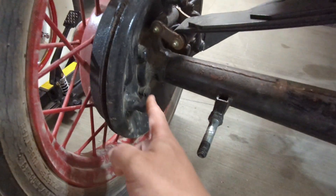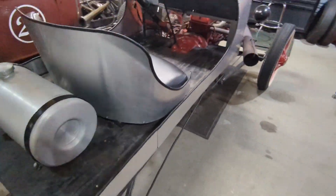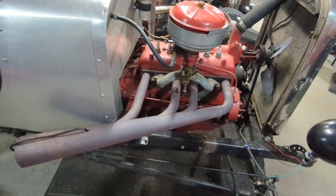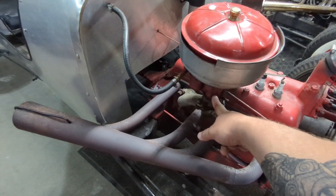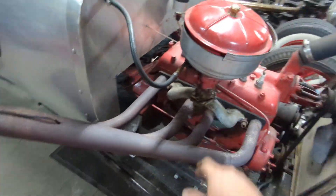We have our lovely mechanical brakes with one adjustment right here, and then the rods that go underneath the car. I guess we're gonna have to learn how to adjust those. I did put the baffle back in — my mother-in-law was not enjoying the loudness, but it's not for everybody. I know it's going to come back out. This carburetor is pretty gunked up — we're gonna have to rebuild it, replace it, or maybe just give it a good cleaning.